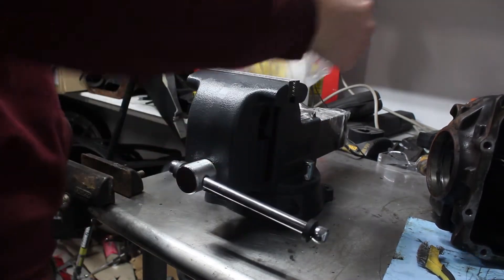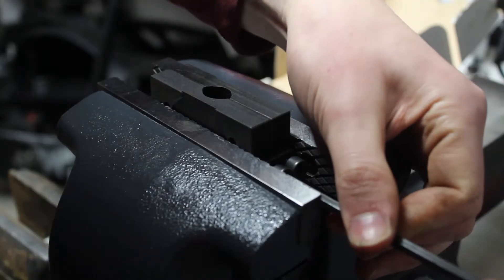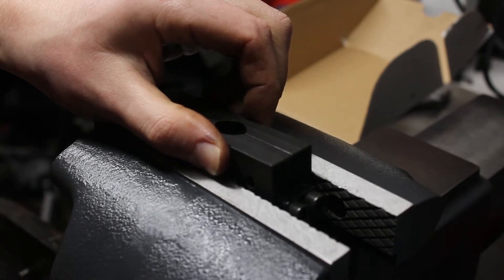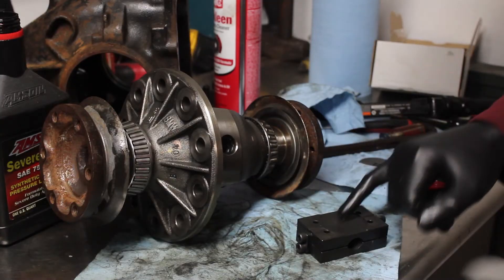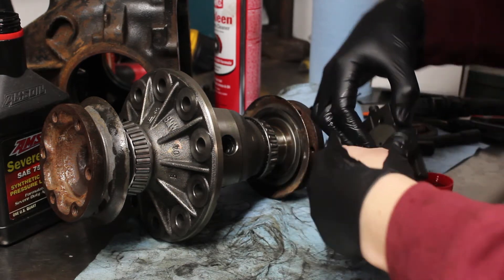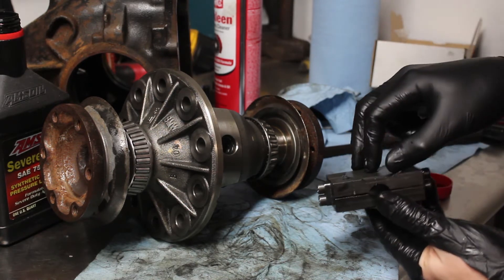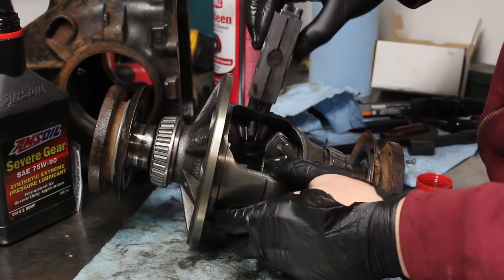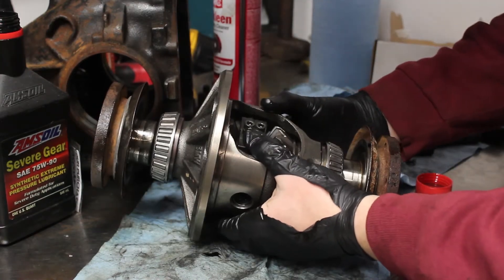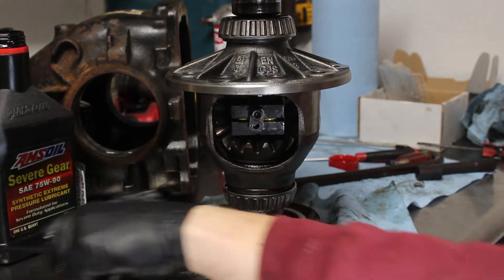With the new vise, I could finally clamp down the kit and install the retaining clips. I didn't even bother bolting the vise down on the table yet to do this. Following the directions in the kit, I put some fluid where the pads go — this is to keep them stuck to the body so they don't misalign when you undo the springs. Notice how my friction pads don't have a circular cutout on the inside; I believe some newer kits do have this to prevent you from having to cut your axle flanges down. I was careful to make sure everything was aligned just right and finally released the springs in the kit. It's a bit nerve-wracking since you never really know when it's going to pop.